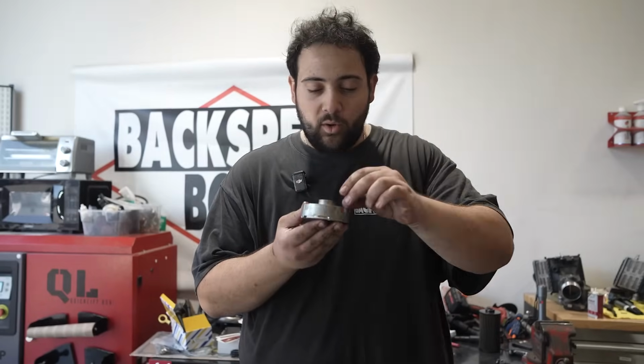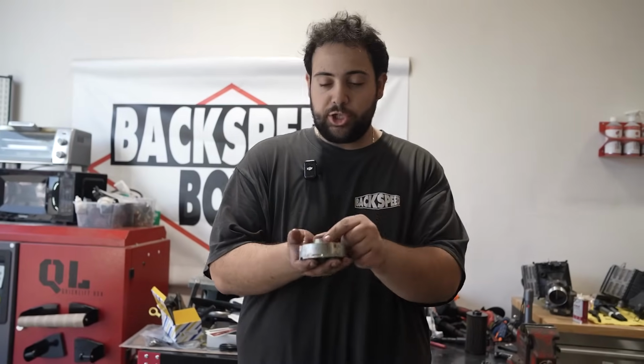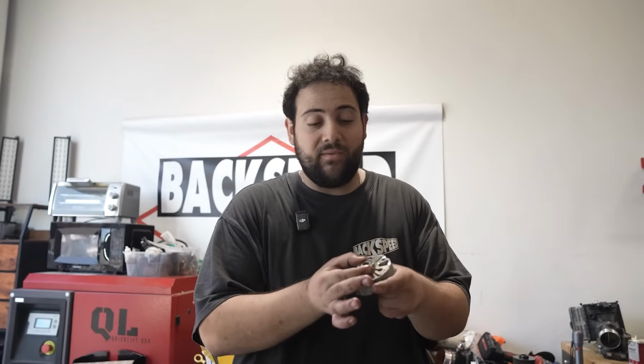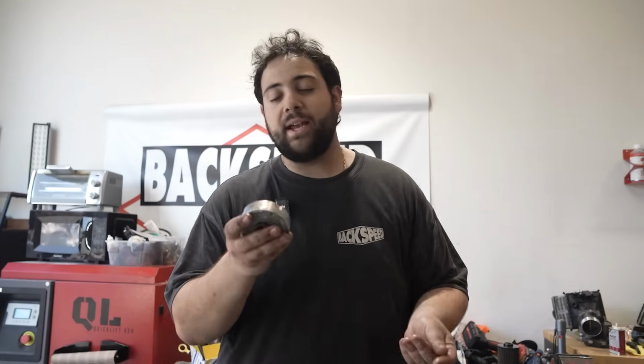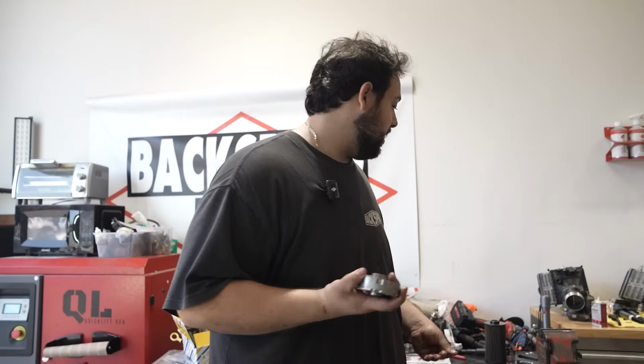This was stuck into one of the little grooves that oil passes through in this thing, which could make it have low oil pressure and not read properly. That could totally have caused the code we were getting. It also could have made it so that this thing can't fully retard or advance. There's a lot of issues chunks of plastic and intricate parts can make. While I'm not 100% sure, I'm hopeful that this all wasn't for nothing, and this could actually have been causing the problem, and we possibly fixed it.